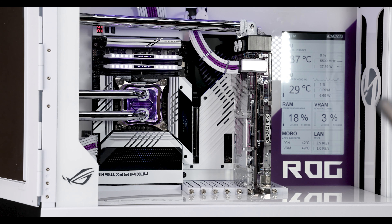That pretty much wraps it up for the overall build. About the performance of the Strix block — not amazing, kind of on par with the EK one. Idle is great; my water temp is 30°C and the GPU is about 29°C, probably just margin of error. But under load, the delta is about 25 to 30 degrees — not great. It is what it is.